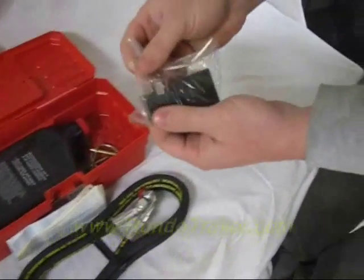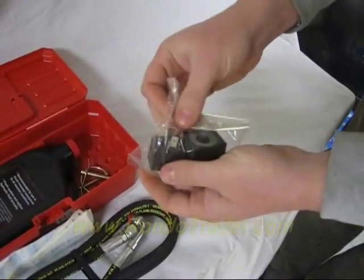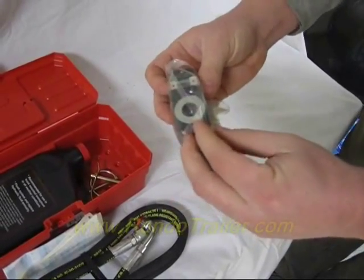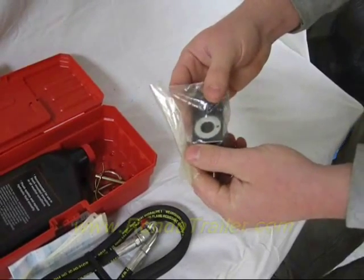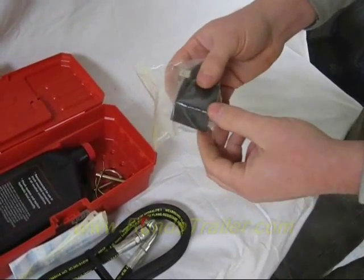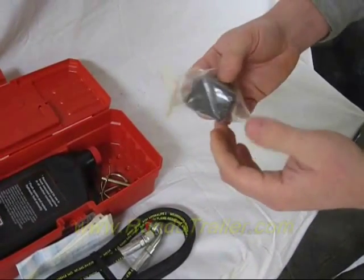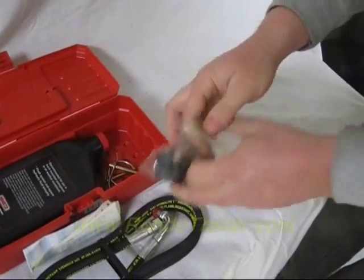Other stuff that's in here — this is the under-hood relay, for your lights and your ignition. You can find that at any auto parts store, but they give you one. This is the big thing you're buying: this is your down coil on all of the plows. It's not the left and right on the straight plows, but those I have done like zero warranties on ever. This is also all of the functions on your C plows and some of the V plows.